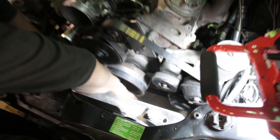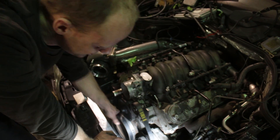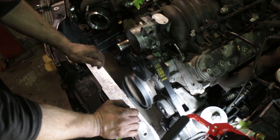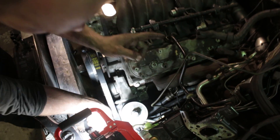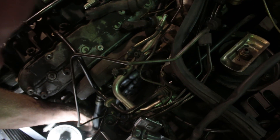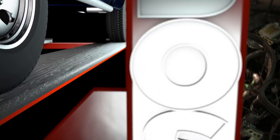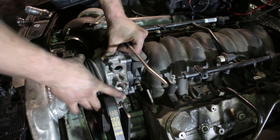I've just enough room for the rad. I literally have like a quarter inch between the front pulley and the rad, but that's okay. My parts guys hate me, but I just say I need a six-rib belt that's this long. I had to make the idler up here to wrap around the water pump to turn it enough. So it's tight — I can just put my fittings in, they just fit up above the frame rail. But the one for the hydraulic shocks is at a 90 and that's going to hit the frame, so I got to build something — either a really tight 90 if I can find it, or get my welder to change the fitting so it points out the back. Really happy with how that turned out. So it fits, but just barely.